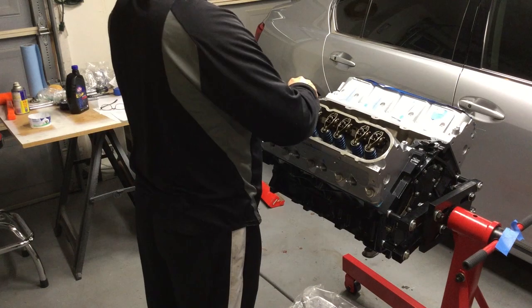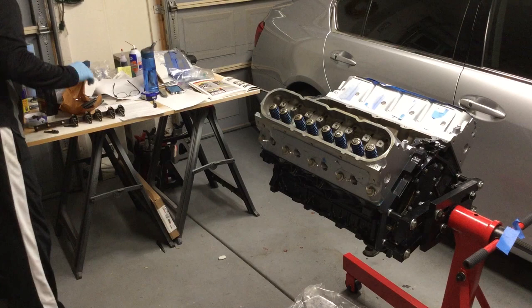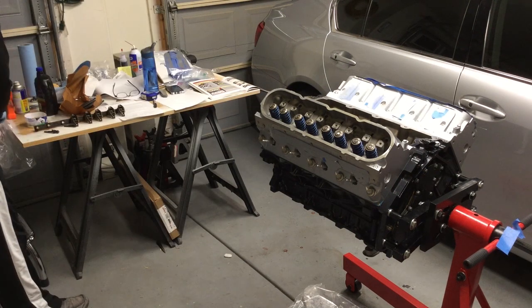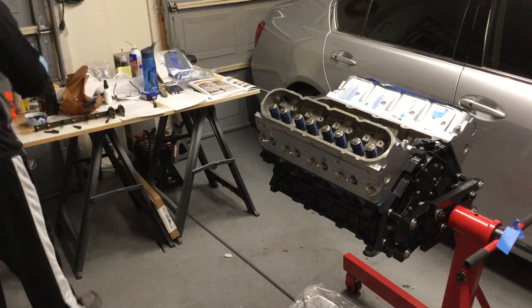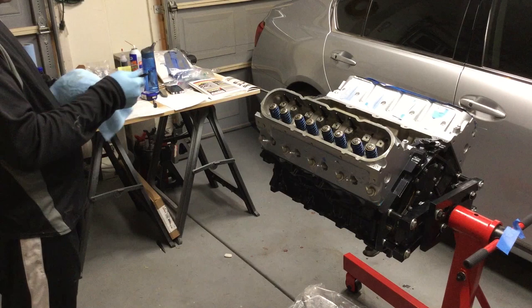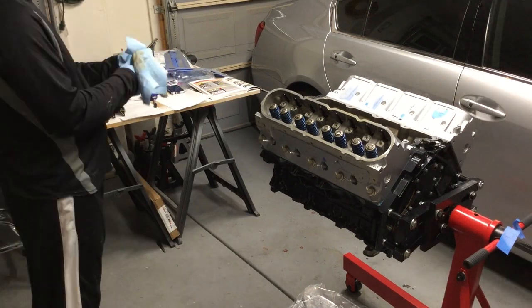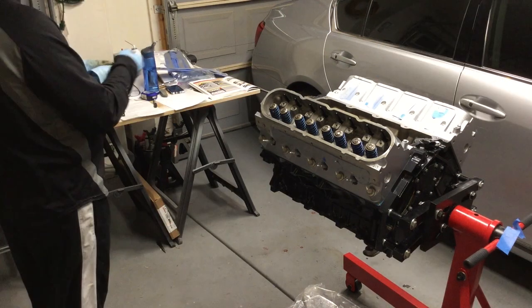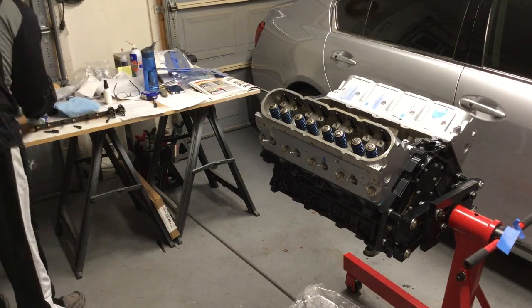So in this last installment, I finally have my heads put onto the block, and we are now going to actually add the push rods and the rockers in. I had one rocker that was a little bit worn, so I got that replaced with another used rocker to match the wear of my rockers, just to keep stuff balanced. I'm following the procedures as the book tells me and popping everything in as it needs to be.